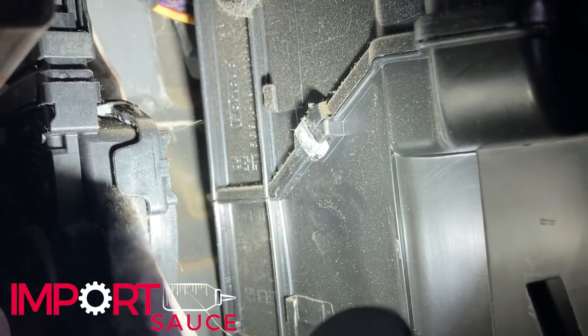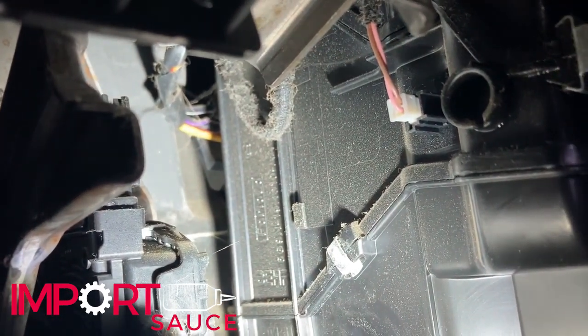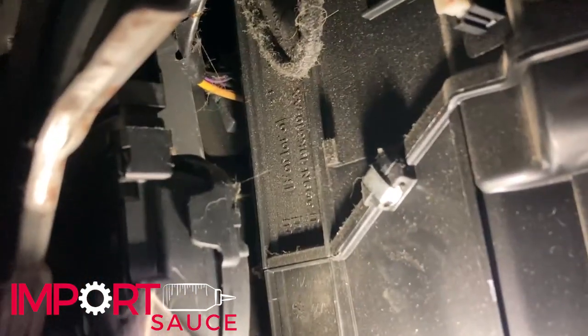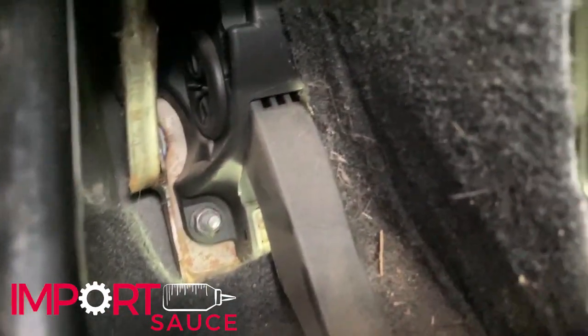So we have the flashlight. We can see the cabin air filter door, and then we can see the wire harness right back there. Let's see if we can zoom in on that yellow-purple four-wire connector. Let me pull this carpet back a little - we can kind of see the shape of it there. So I'm just going to reach up and try. Hopefully we don't have to pull the pedal; if not, it's going to be three 10-mil bolts that get this gas pedal assembly off.